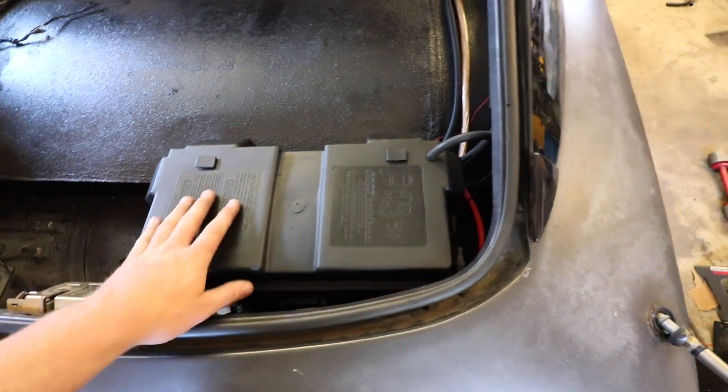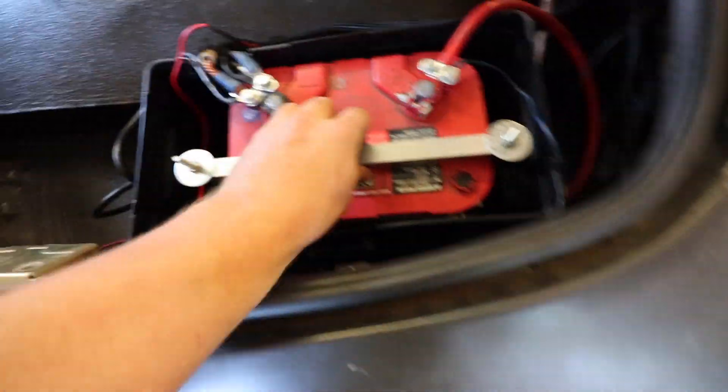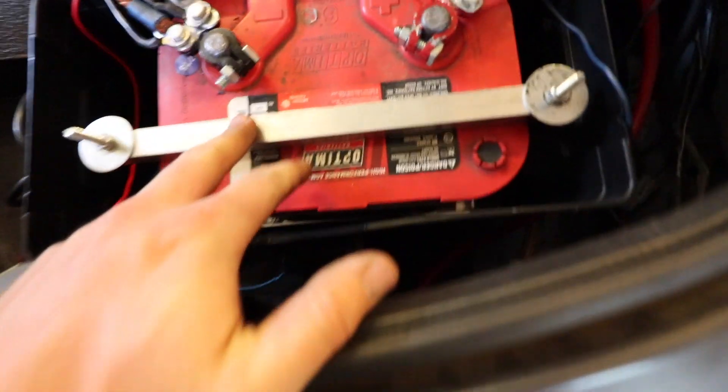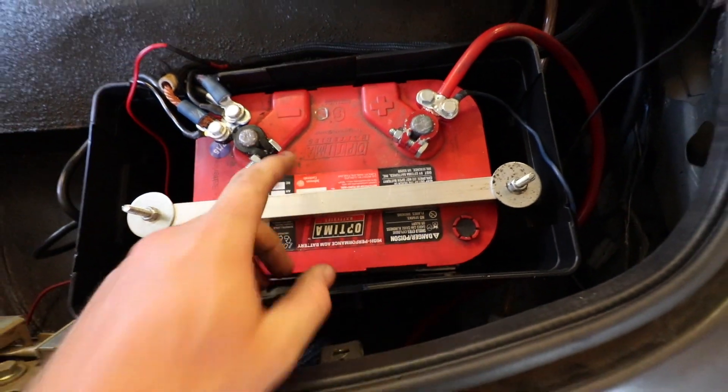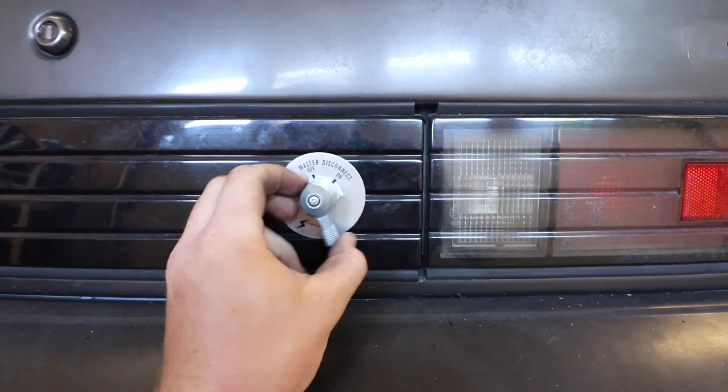I got the battery all set up back here. It has a plastic box right now, but the track just says it has to have a box and be vented to the outside. I made a tray out of angle iron that holds the battery nice and tight, then bolted the tray down to the chassis so it doesn't go anywhere. I also got a smaller hold-down bar so it doesn't get close to the terminals and arc out. Got the switch back here — I did crack it a little bit but you can't really see it and it should work really good.